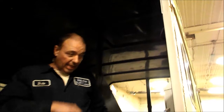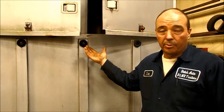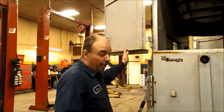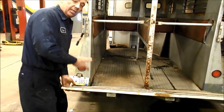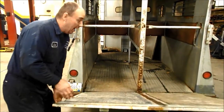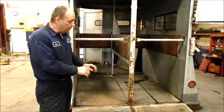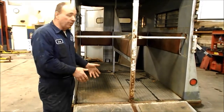Once you've checked the floor and it's in decent condition, definitely check it at the back. This is a straight load, and you want to check the very back to make sure that floor is in good condition because all the urine ends up at the very back of this trailer. This trailer has a rear ramp with two dust doors — make sure the latches function properly and the doors swing all the way back. Also pay attention to your ramp door: check to make sure it opens and note how heavy the ramp is. This one is getting kind of heavy, which tells me the springs that help lift the ramp are starting to get worn out. And since this Jackson is no longer in business, getting those components to repair it would be very expensive.